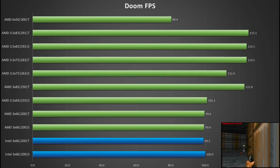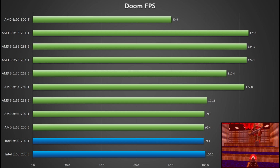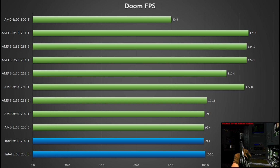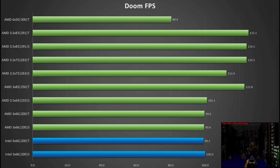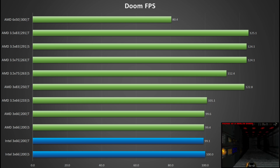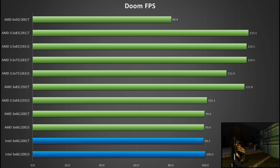Doom takes advantage of multiple variables: the external clock speed, the CPU frequency, and the memory timings. The AMD processor is about the same speed as the Intel at the same clock frequency. However, if you're upgrading to an AMD K6-2 and clock it at 300 MHz with an external clock speed of 50, you actually get a performance regression. It would be better to stick to your Intel CPU.